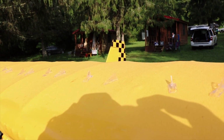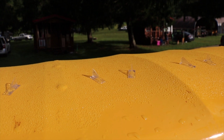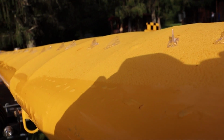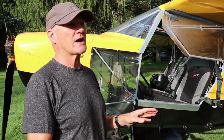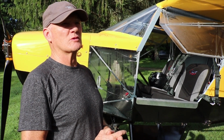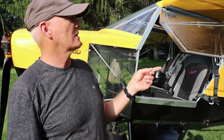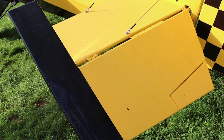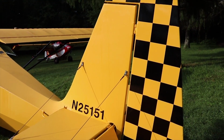Yeah, so I decided to go with VGs on the leading edge, mainly for the slow flight, and I think it probably just enables a little bit slower flight, stabilized, coming in for low, steep approaches. And we also have the VGs on the underside of the horizontal stabilizer, and all of it works together mostly for the slow flight and landing, and so I'm glad to have those.